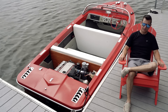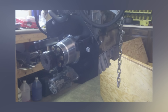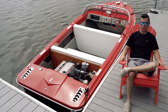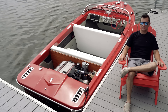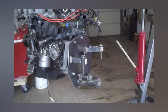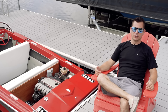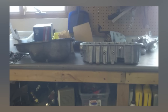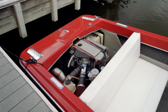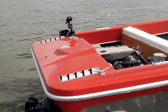There's no transmission. I had a friend who does CNC, and I had to make basically a cone that bolts directly to the flywheel from a manual transmission car. Off the end of that cone is the adapter that goes to the output shaft using a marine adapter — it's got a little rubber insert and metal splines for a little give when you shift in and out of gear. Getting the engine mounted, I had to build front legs that sit on rubber bushings to mount the motor to the floor of the boat. I also had to get a Mark V R32 oil pan and oil pump because the aluminum pan is about an inch shorter than the regular pan on this '95 GTI motor, giving enough clearance between the bottom of the engine and the floor.